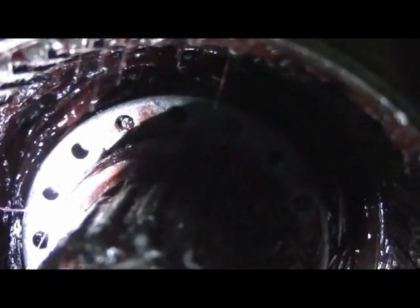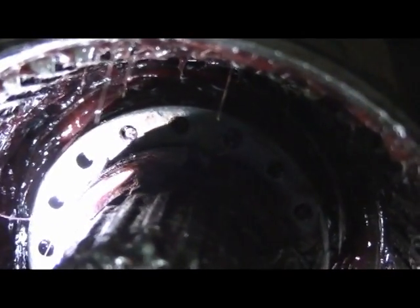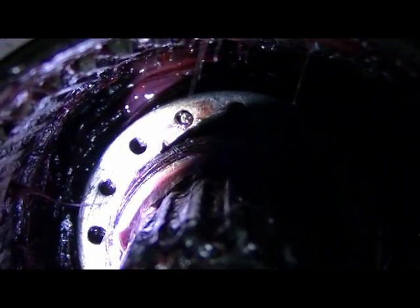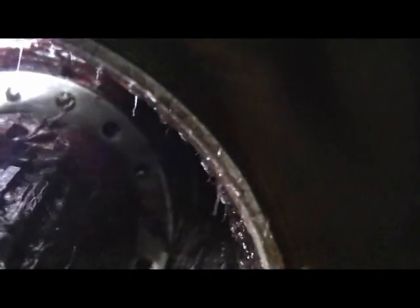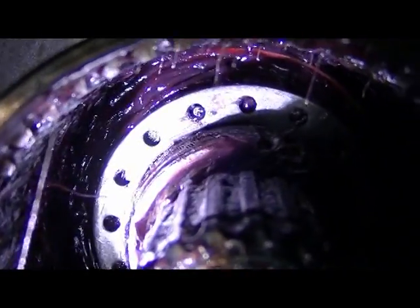All right. Looking at the lock ring, you can see that I got the pin meshed in that 11 o'clock hole from the spline keyway. That's kind of hard to see, but I know I can see it right there. Again, critical. Got to make sure you get it in there, and then the lock ring lays flat on the inner lock nut, meshed with the pin. Alright, and then you get your keyway set up properly. It's in there, trust me.